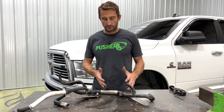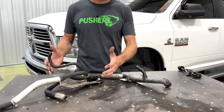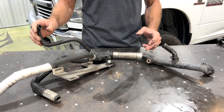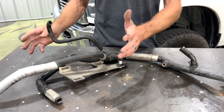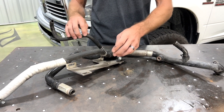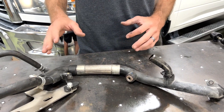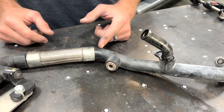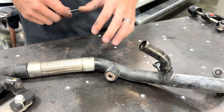Now that I have all this out of the truck, I'm going to start prepping my coolant riser tube for the adapter. This is still relatively assembled because I did basically the bare minimum disassembly to get it out of the truck. I'm going to cut it here and all this gets replaced with new components. If you find it easier to remove the individual hoses and bracket, that's fine. Prepping for the adapter, we're basically going to cut this tube right here.